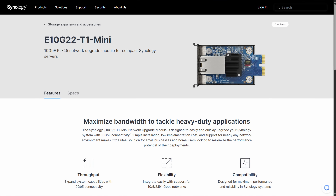Next would be upgraded networking. Networking is kind of tough because it really depends on the type of device you're using. Using something like a Synology DS923 Plus, for example, you can buy an adapter that allows you to use 10 gig, 5 gig, and 2.5 gig networking. Now, an individual hard drive will not saturate a 10 gigabit connection, and neither will four hard drives. So if you have a DS923 Plus with four hard drives, you will never saturate a 10 gig connection. Going the official Synology route is best because it's a supported device, but the downside is that it's expensive.